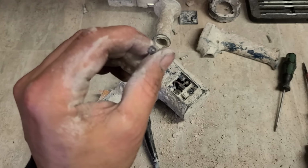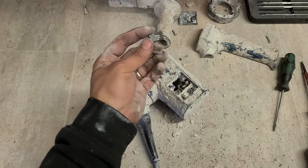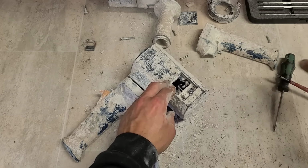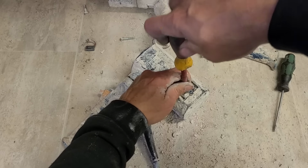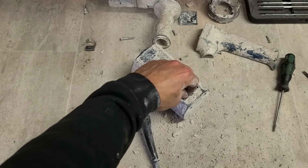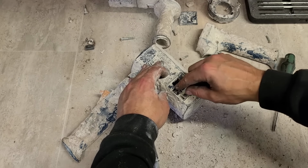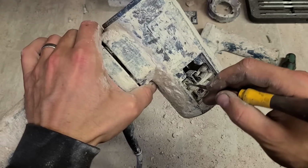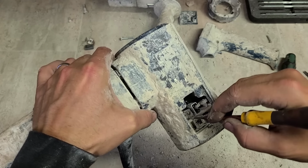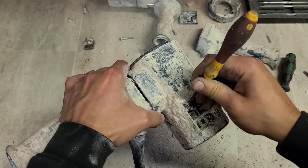There's the problem there. That screw sheared off. Brush is still okay. I imagine the holder's gone. There's the cable there for the field, and that's still intact. So the field is actually not at fault. Just get that out of the way.